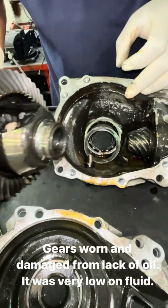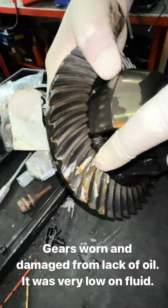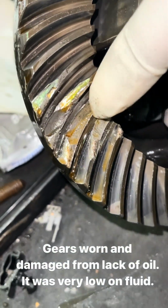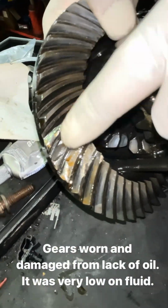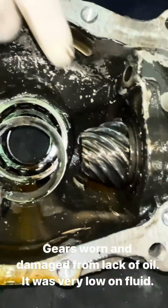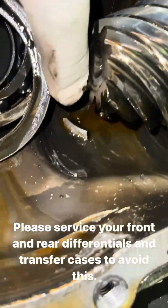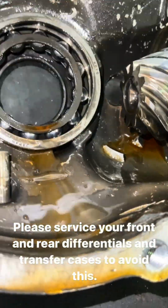This all is to a front differential. It's nothing but a ring and pinion. Look right here. Look at the broken teeth on the ring here. That's what was causing our knocking noise. It was slipping. If you come right here, you can see all the damage it did to this. You got metal down here, metal throughout the whole thing.